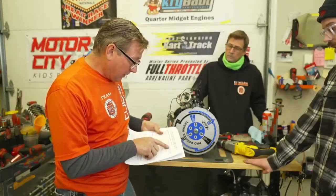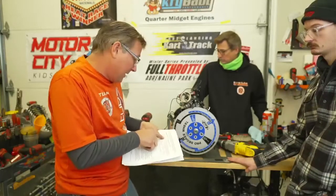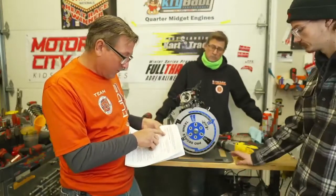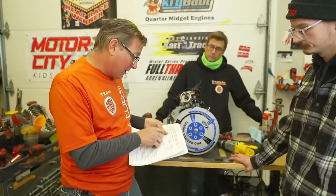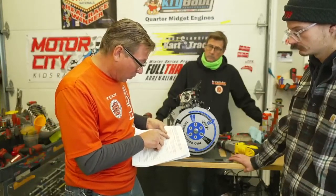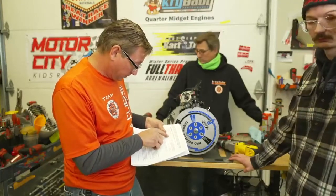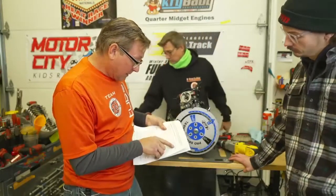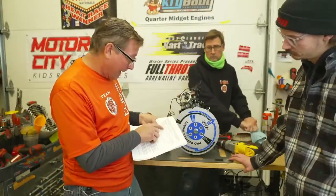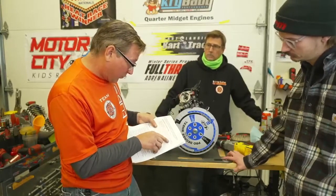So they're giving you a range of 20 degrees, never exceed 20.5. Well, the thing is, man, I'm an engine builder, I want 20.5. That 0.5 degrees, in my mind, is worth something, so I want it. So now I have to try and hold it at 2000, which is hard. It says any RPM below 1200 and above 2000 is not following the proper timing check procedure.